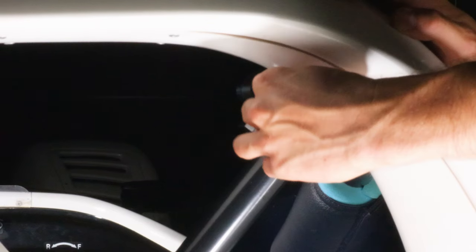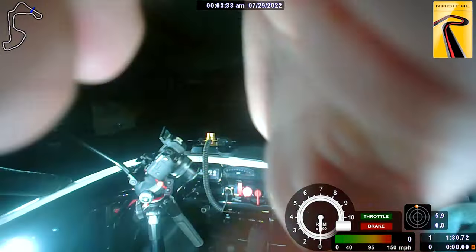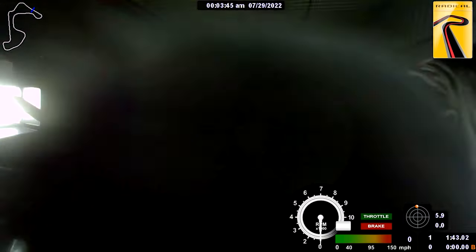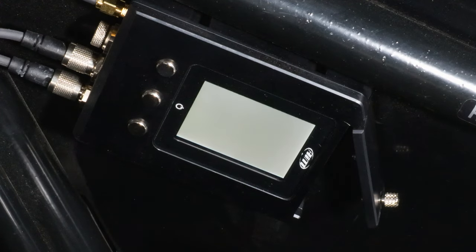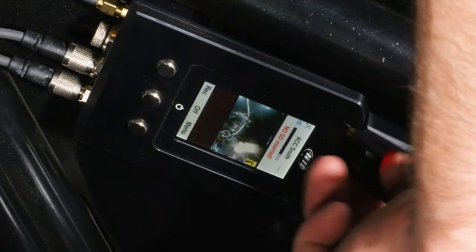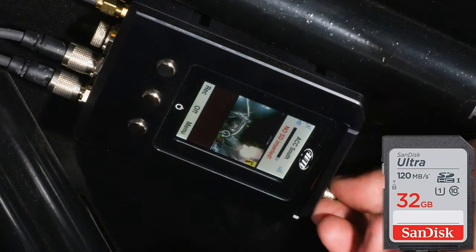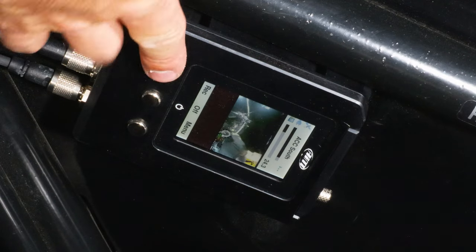Now we will check the recording system to make sure that it is correctly oriented and functioning properly. Check all the wires leading out and into the camera box and the camera itself to establish that everything is correctly plugged in. Clean the lens of the camera with both degreaser to get the bugs off and glass cleaner to make sure there are no streaks and the view is clear. Press the power button on the box or turn the car's electronics on and let the video box load. Make sure there is an SD card inserted with more than 5GB of storage with a read-write speed of at least 90MB per second. Make sure the orientation of the video is correct and not sideways, and verify that it is recording.